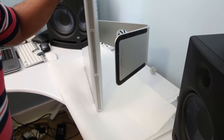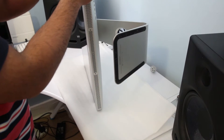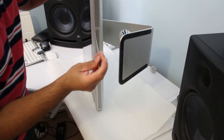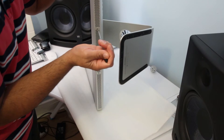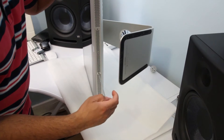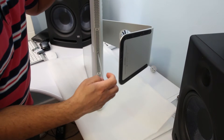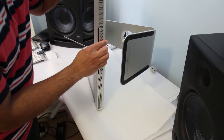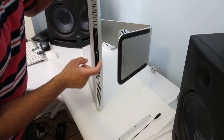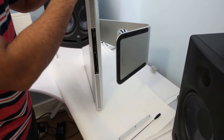I'm going to zoom in. You can see the RAM is installed here. There are 3 Phillips screws here and I will unscrew them — this is my screwdriver. Very gently unscrew — don't scratch your iMac. This is the 3rd screw in the middle. This is the empty slot where I will install the RAM module.